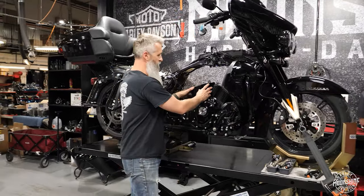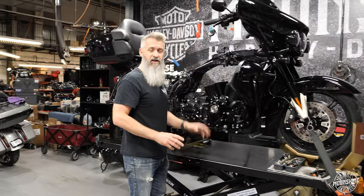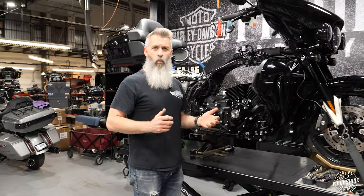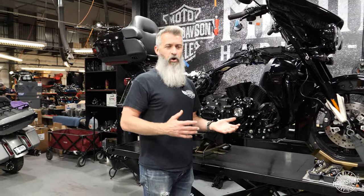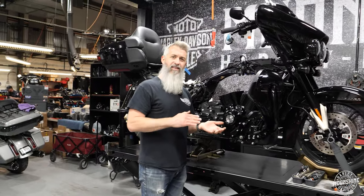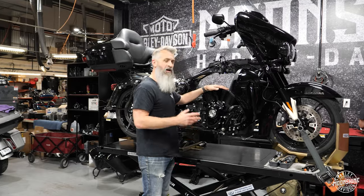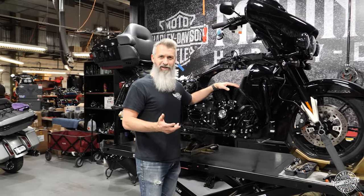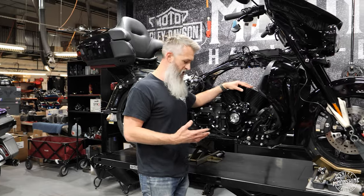When we do our Highway Sleeper, we go with a little smaller camshaft. We are going to run the S&S 550. It's a little better on wear and tear, a smoother combination — we're not going with a 600 lift or anything over 580. It's a real mild camshaft on the setup, a ton of lope at idle, which you'll hear at the end of the video, so you have great sound, but longevity is going to be there.